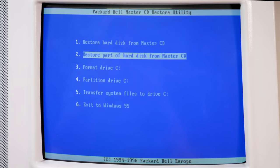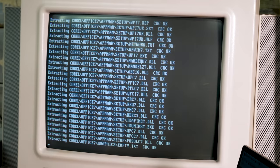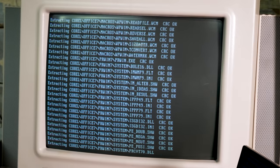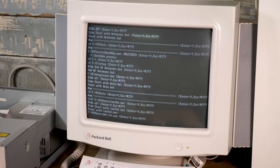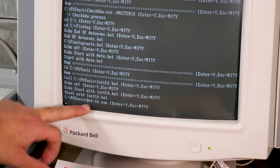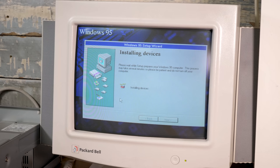The program we need is also on the CD — it's called OEM Setup — and when we restore it, nothing smart is actually happening: it's just dumping the entire archive onto the hard drive. After the first reboot I did hit a snag. It tried to run DETCD, an executable from Packard Bell which tries to detect which CD-ROM drive you have and then sets up the drivers for it. Since I've already upgraded mine to a newer 32-speed CD-ROM drive, it just hangs at this part of booting. The workaround was to disable that line at startup and use the good old Oak CD-ROM driver, and then things carried on as normal.